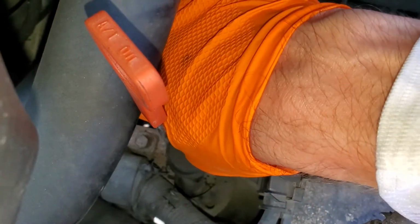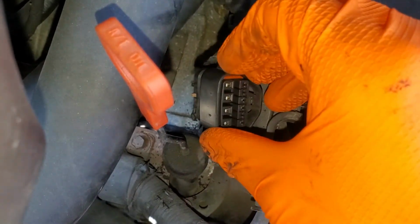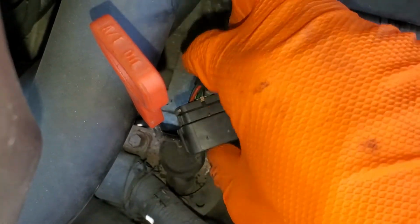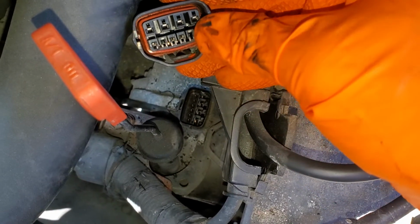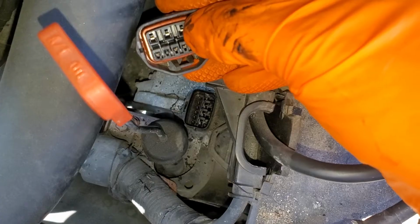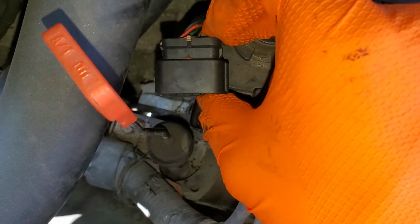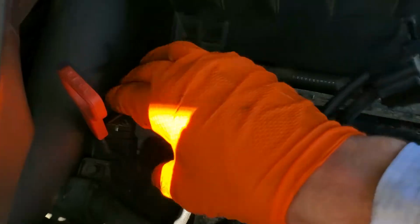The power goes through that burglar relay, and then it goes into the switch on pin number 10, which is that upper right hand pin with the gray wire. When this switch is working properly and when it is in park or neutral, the neutral safety switch will connect this pin with the pin next to it, pins 10 and 9. And pin number 9 will go directly to your starter relay, and it carries power to it to energize it.